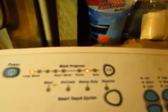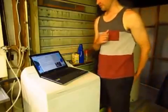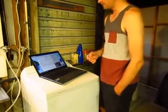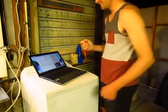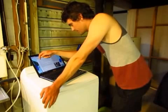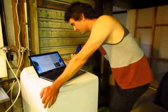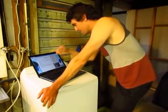So obviously the first thing anyone does when they get a problem like this is you Google it. So this is what I found on Google. From my adventures on Google, I managed to find a piece of the manual for this washing machine which had an explanation of the error 130. So error 130, or in binary 10000010, it says it's a phase 1 to 6 single rotor position sensor error. I don't really know what this means either, but it has an explanation underneath this.